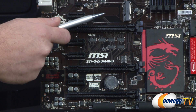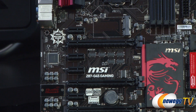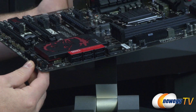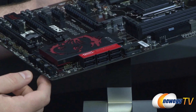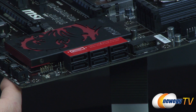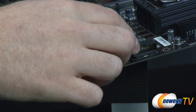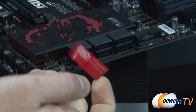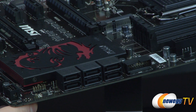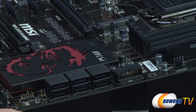There's also an mSATA slot just above the PCIe area where you can install a small mSATA SSD — and it runs at SATA revision 3 speeds, which has been hard to find on a desktop board until now. Using that slot will disable SATA port 6 on the lower right. Speaking of which, all Serial ATA connectors on this board are SATA revision 3 at six gigabits per second, all natively controlled by the Z87 chipset for lower latency compared to add-on chips.